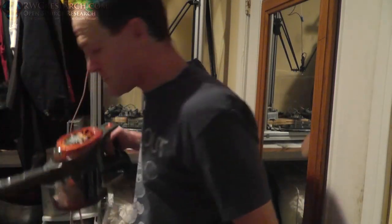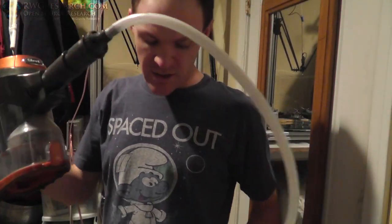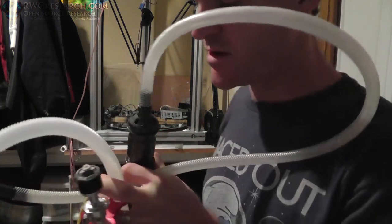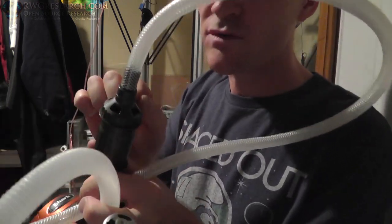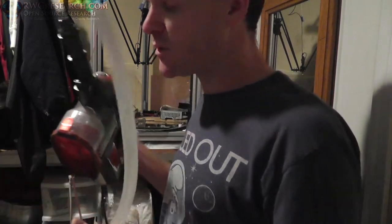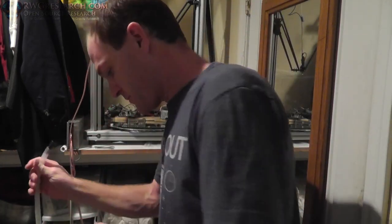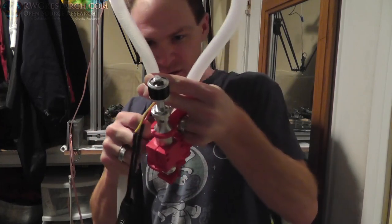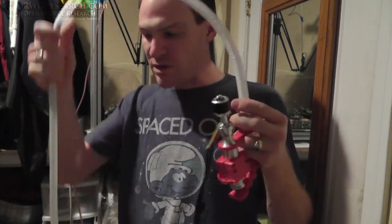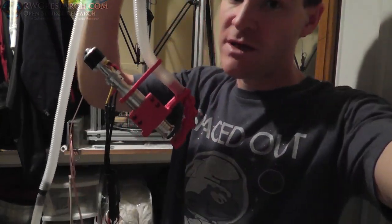This end gets hooked up to the vacuum. I'm going to try this although it's really really loud. This is a shark vacuum but it has this attachment pre-made that has a small hose on it. On the end of this right here there are holes, and by twisting this you can open or close those holes — it doesn't allow you to close them all the way, and that's because otherwise you'll burn the vacuum up. Don't put a small hose on your vacuum without doing something like that. This attaches on the end here really nicely — just so happens to fit this pipe, which is just a piece of flex tubing that's a little more flexible than the one on the vac. Then yeah it just sits in there. Let's put it on there temporarily to show what it looks like.